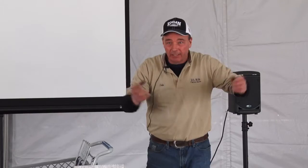But let's say now I'm going to take a friend and we're going to put 2 horses in, and now I'm going to put a bunch of hay in the front and supplies, because we're going to camp for the weekend, and you're going to drive 60, 70 miles. You'd better raise your air pressure up, because now they're going to get too hot since it's too low of air pressure. So you have to adjust the air pressure in your tires according to the payload of what you put in. And most failures are from that. And if you've ever blown a tire on a horse trailer, you're having a fender fixed too, because it tears them up. So check that. And there again, like I said, dry rot, that kills tires too. And if you want to save your tires and you keep them outside, go to some type of camping supply for trailer tire covers.